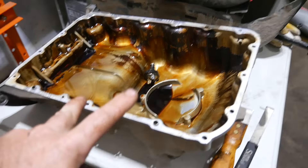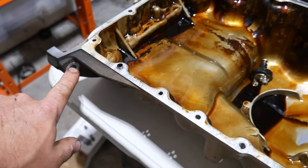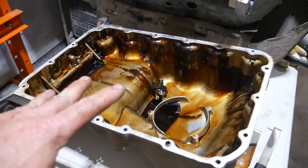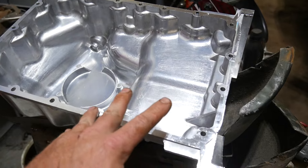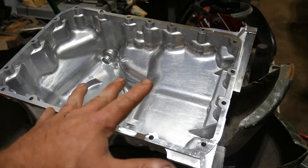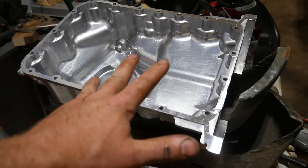What I like to do on these pans that are a little more involved — it's tight in there and you've got bolts going this way, these are 17s, so it kind of gets wedged up in there a little bit. I'll take the new pan before I put the silicone or the gasket on and just practice routing it up in there a few times. Because if you get this all gummed up with silicone and then get jammed up somewhere, you're going to have a whole mess.